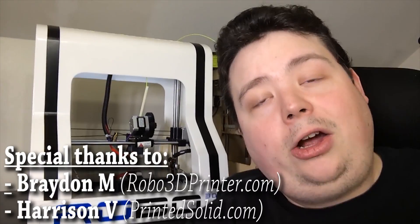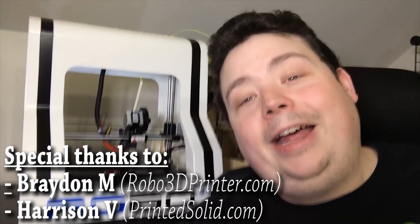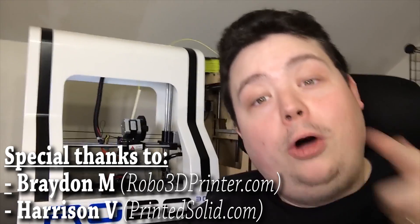Guys, hang in there. If you're having problems, invest in an E3D print head, take your time, and get these mods installed. I guarantee you're going to have a way better experience with the printer. I haven't had any problems with the heated bed - mine's holding perfectly at 70 degrees and everything I print with a little hairspray on the surface sticks like a magnet. Let me know if you're still having problems with that. I hope this video boosted your confidence in the Robo 3D printer. Any printer you buy that you're going to build yourself for $500 to $700 is going to have quirks you'll have to work out. That's just the nature of 3D printing. In five years you'll probably be buying these from Epson and Hewlett Packard as turnkey solutions, but I'm glad I'm in on the ground floor and I hope you are too.